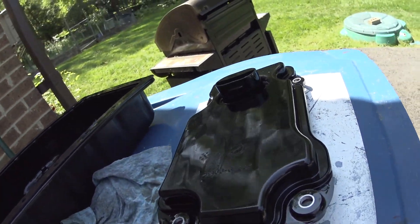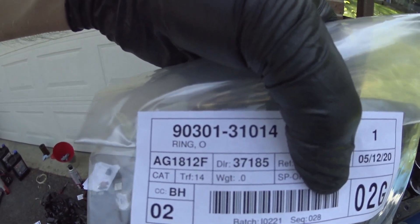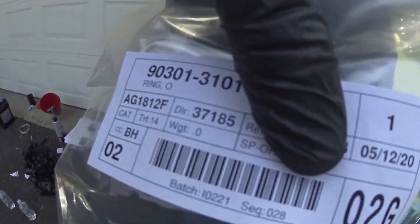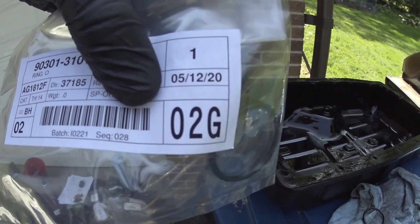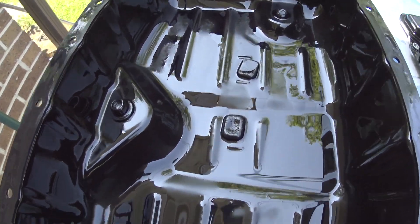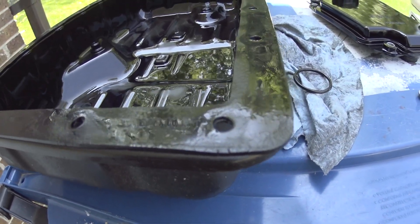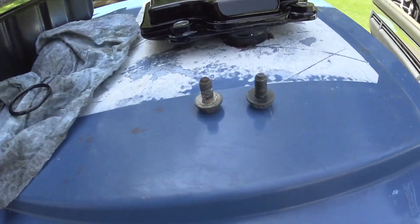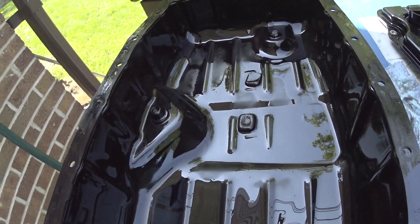Here's the old O-ring and the new O-ring — there's a part number so you can confirm you got the same O-ring. That's the part number for the O-ring for the transmission strainer. Now I'm going to clean the oil pan — as you can see there are magnets in there, with fine metal particles on them. Clean the oil pan, and I'm going to replace the gasket. The gasket doesn't look like it's been replaced, so probably the transmission pan was never dropped. You can see little cracks — that's what I mean by organic erosion.